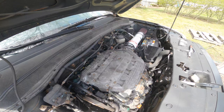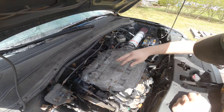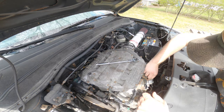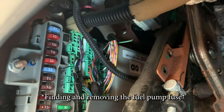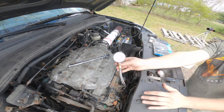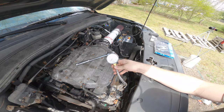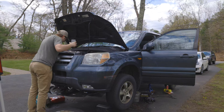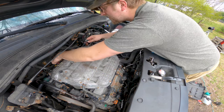Cylinder compression test, let's do it. Smells like burning substances. Proceed to take spark off of spark plugs. Number one, right there. I'm going to go ahead and pull that out. Just crank it over until I say stop, okay? I'll yell at you. All right, stop! Beautiful - so that cylinder was 210 PSI. We're going to go to cylinder three now, which we know is misfiring.